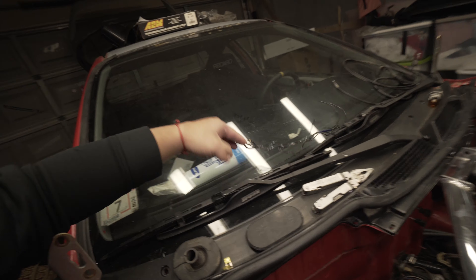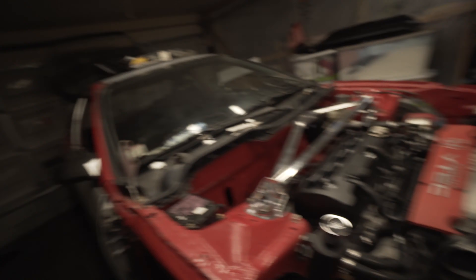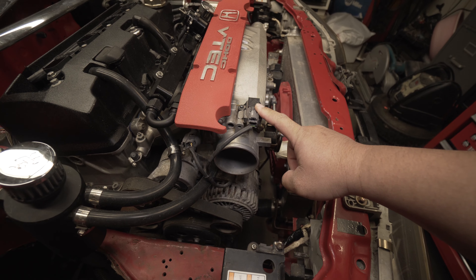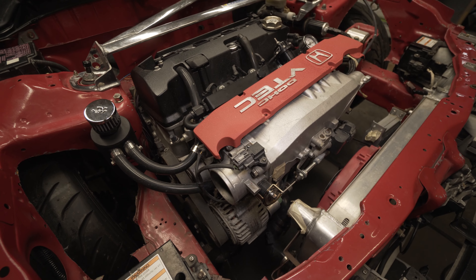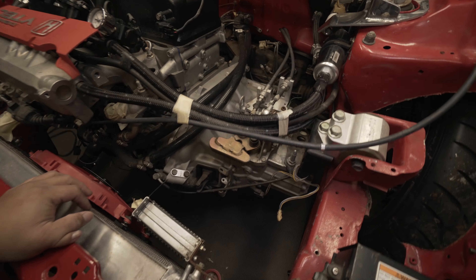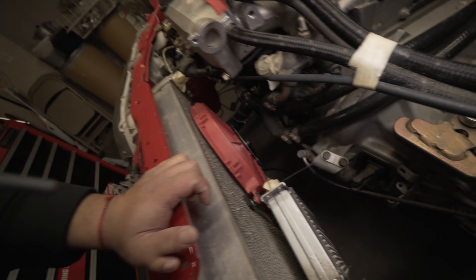The goal is to clean that up, run it through the firewall, plug it up, power the ECU, ground the harness, and build a bunch of grounds for the engine head, block, and transmission - about seven wires that need to go from the ECM harness to the dash. Once we get the ground for the harness put back in, we should be able to fire up the ECU, load a calibration, read the throttle, and get feedback off the sensors. That's the map sensor - it's a four-bar - and I'm thinking about swapping it back out for a two-bar because four-bar is just too much for this application.